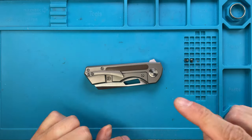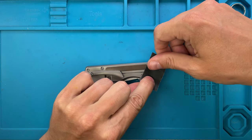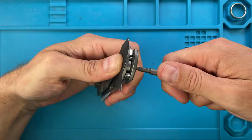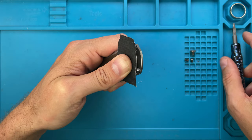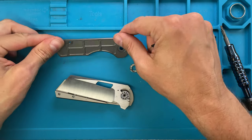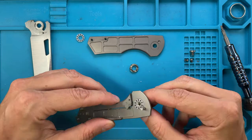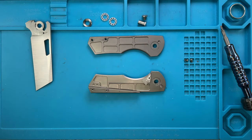So I'm just trying to apply some pressure on this side. This pivot is spinning — no problem. Get a little bit of duct tape to block this side so it doesn't spin, then apply pressure on this side with my thumb. Yeah, it worked like a charm — there's some loctite. That's the trick I use to take these down. Boom, look at that — pretty simple, comes out nicely. We're gonna clean it up. Let's pop the bearing out, the pivot out, and there's the collar — nice, done.